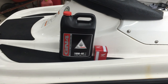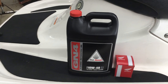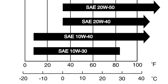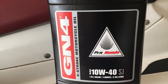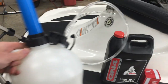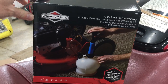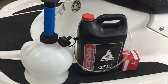To start with, I have a new oil filter and 4 quarts of Pro Honda GN4 motorcycle oil. I went with 10w40 based on the average temperatures where I'll be riding here in Ohio. I ended up needing a little more than 4 quarts, so I bought an extra 4 quart jug to keep on hand — or just an extra quart bottle will do. You'll also need an oil extractor pump. This Briggs & Stratton one was 39 bucks on Amazon and it holds 4 liters. Links for all of these are below in the description.